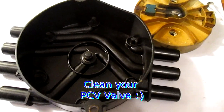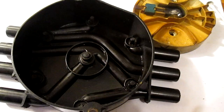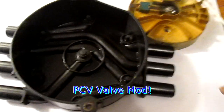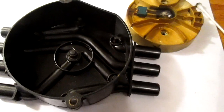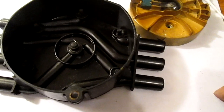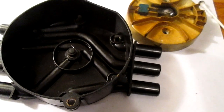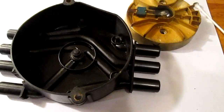Another thing: if you have moisture and a little bit of coolant blow-by, I would suggest putting in an oil catch can and cutting the PCV valve — I have that in another video. Once I cut that, it was able to release all the moisture. Make sure to plug your vacuum tube or you will have vacuum issues, because the PCV works on a vacuum system. The tube that comes out of the PCV goes into the vacuum — make sure to get a plug and plug that.